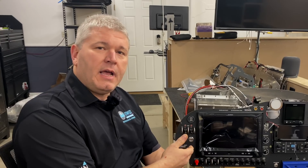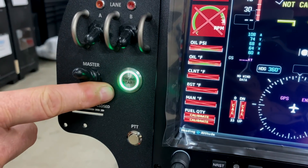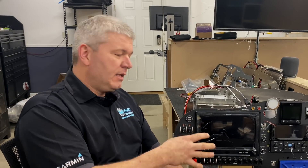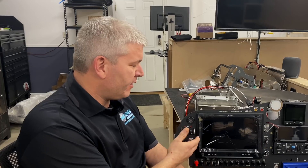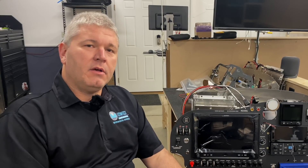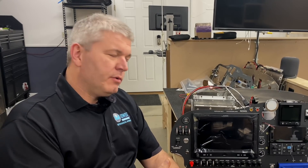The new system uses a push button. We have a master switch and we're going to isolate that because we don't want the button to actually control the master itself. That's one of the failure points we wanted to build out of this system so that we wouldn't lose electrical power in the event of a system failure. We really did have to think a lot about the different scenarios that might happen and how we could avoid that.